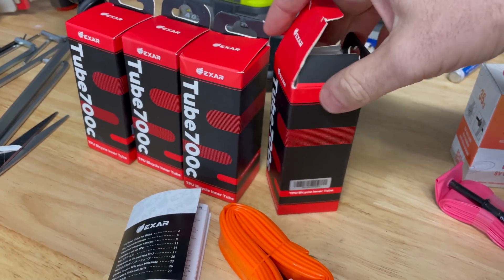Now to the installation of these tubes, and a bit of backstory about why I'm converting these perfectly fine tubeless wheels and tyres over to tubes. It comes down to maintenance — this bike gets ridden outdoors probably once or twice a month, and to be honest I cannot be bothered checking sealant levels. As you can see, there's next to no sealant in these at all. So: less maintenance having tubes, and some hands-on to find out what these tubes are all about. The tyres are in pretty good condition — they're Pirelli P0s, so back on with those. A little bit of air in the TPU tubes, and to my surprise these were a lot easier to install than latex tubes. They held their shape, there was no pinching, and they just blew up very, very easily. The tyres seated quite well. The hardest thing was that anti-rattle sticker, which took a minute or two to clean up the rim and get stuck down. Once that was done, good to go.